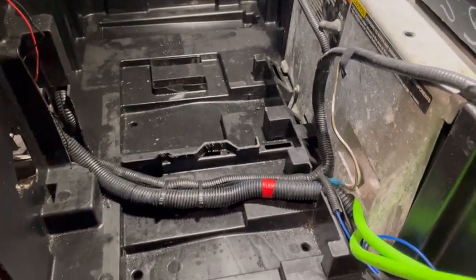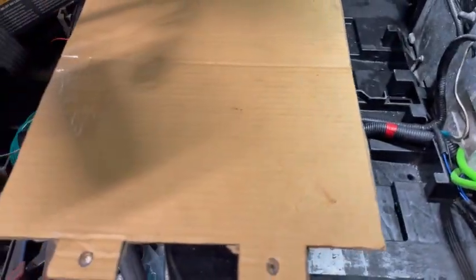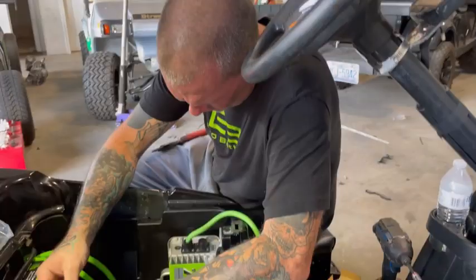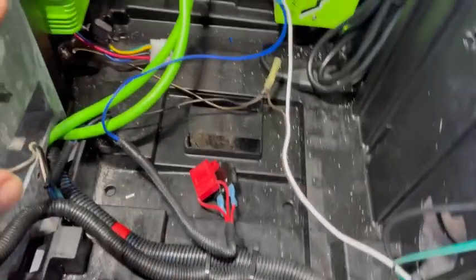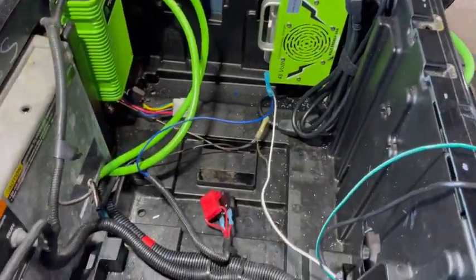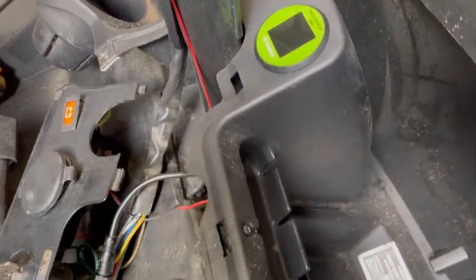This is what you should be looking at so far — we've got ample room to put in that big battery. We've made a cardboard template to give us a rough idea of battery placement: pull out your battery from its case, set it on cardboard, and make a template like this to see where your mounting brackets will need to be positioned. John has already run the key switch enable wire for the reducer from the key switch blue wire back to the reducer, extended the accessory wires for the USB port and light harness. The charger is mounted, the reducer is mounted. Using a two-inch hole saw bit, we've got the Bolt gauge mounted into the dash right here, with the pigtail hanging down below ready to connect to the harness.